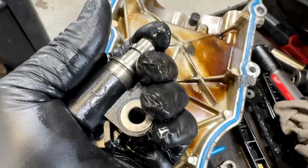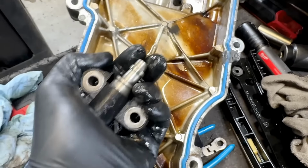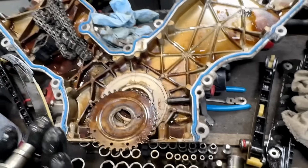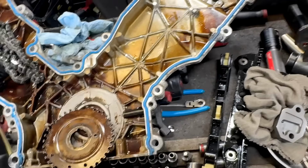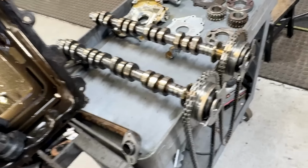Now it's starting to move with this a little bit. I wonder if them fully tensioning out and locking, getting hard wedged, whatever, is actually what's causing these chains to break. You've got to think about all this stuff when you go to buy a timing kit and do this. Not only is it a lot of work, but if it breaks, it's an interference engine.